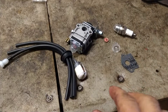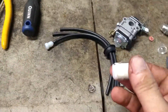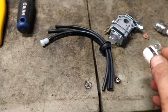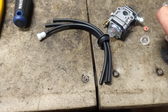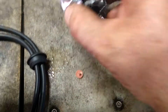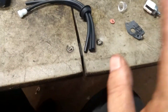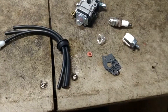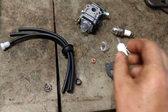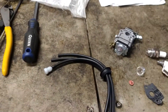This kit comes with a filter also, but it's much too large to fit in the tank. The fuel line kit I get you will have a couple of filters — I'll put that in the description as well. It also comes with a couple of spare primer balls, a little pink one-way valve that goes underneath the primer ball, and a brand new gasket. So most everything you need is in there except for the fuel lines and a filter that'll actually fit.